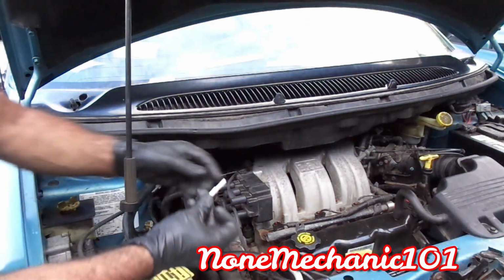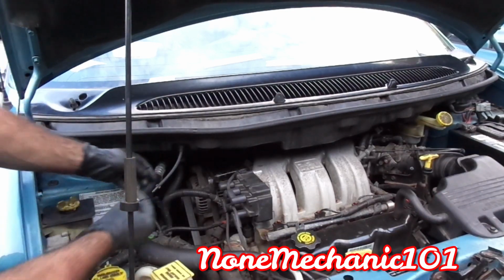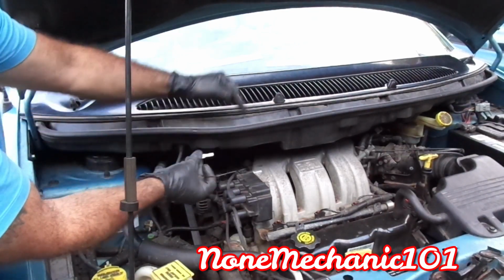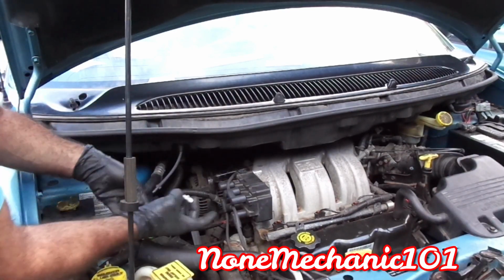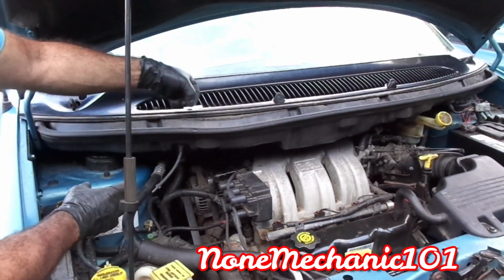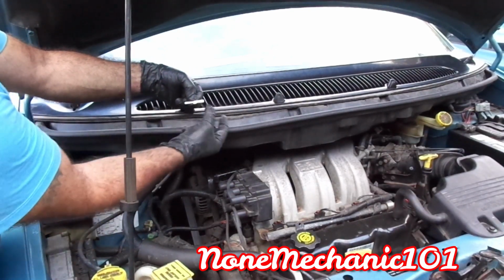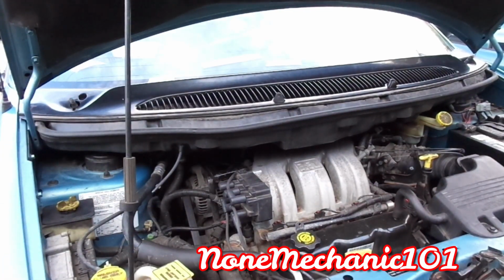What I used for that plastic piece was this one right here. This side has to be small, and this one a little bigger, in order to connect right, so you won't have a spill when you press your wipers and the fluid comes out. So if you do break it, make sure this side right here is fatter than the one on this side. Okay, let's continue on.